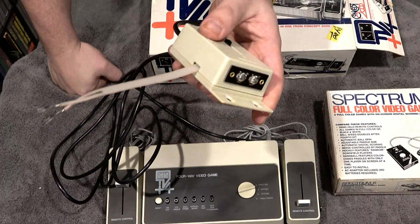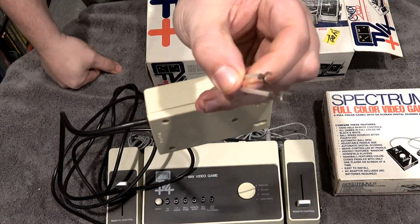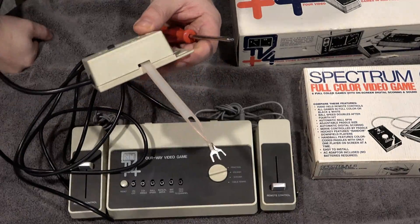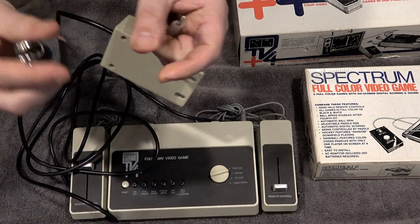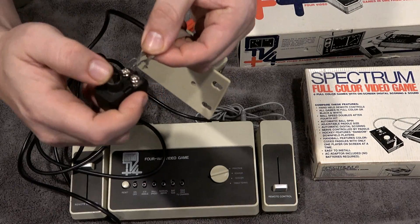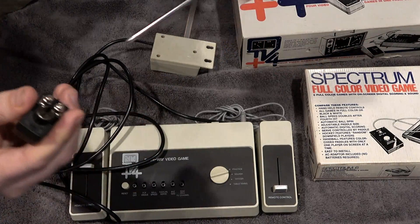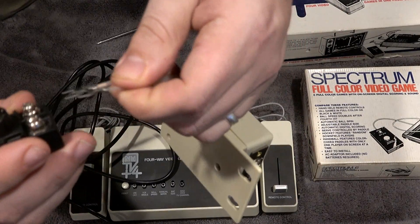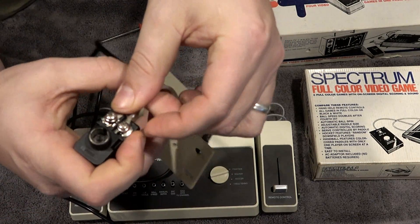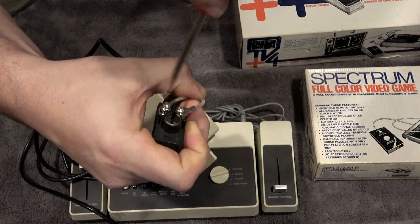These hardwired connections can be a pain, so I actually need another device to hook it up to my VCR. What you need is one of these — a push-on TV antenna adapter. You slide the prongs in, unscrew the terminals, fit the prongs in there, and tighten the screws. Voilà — now you can hook this up to a modern TV with fewer issues.